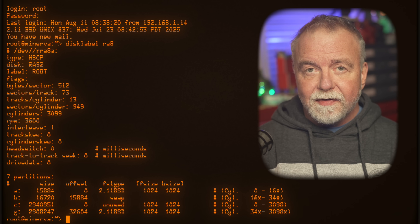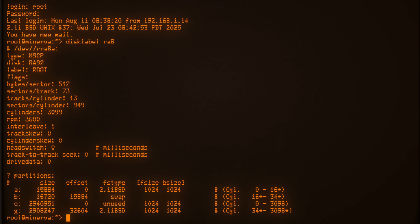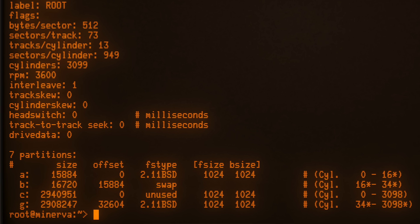If it's been a while since you worked with even a vintage PC hard drive, there are three steps you need to undertake. First, you need to do a low-level format - the process that actually goes through the entire drive and prepares the raw sectors to handle future data. You don't do this ever on a SATA drive; it's already done for you at the factory. Next, you need to create the partition table, which uses sector offsets to define regions of the disk that will become independent volumes. And finally, you have to create file systems on those partitions and then copy your data to them.